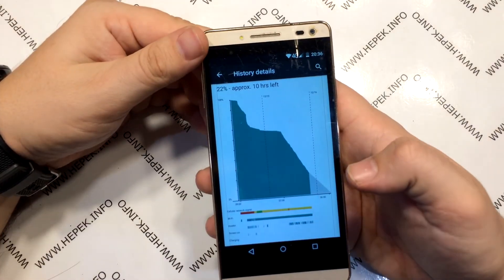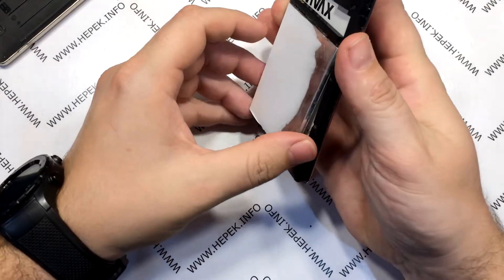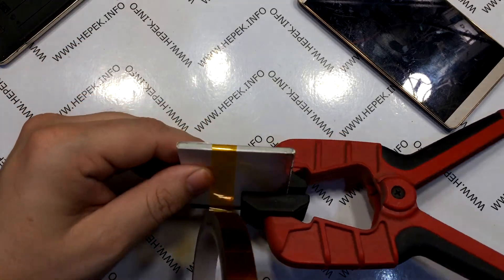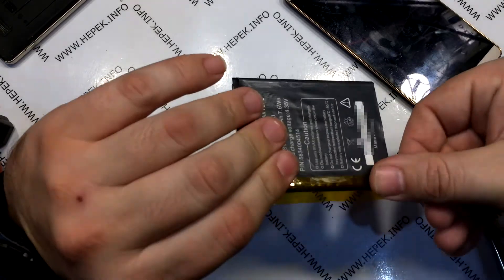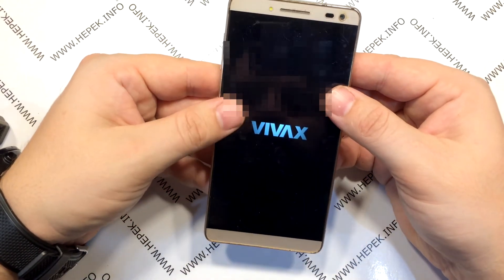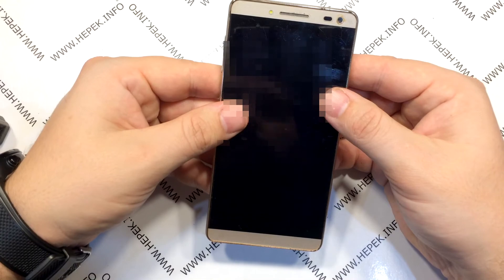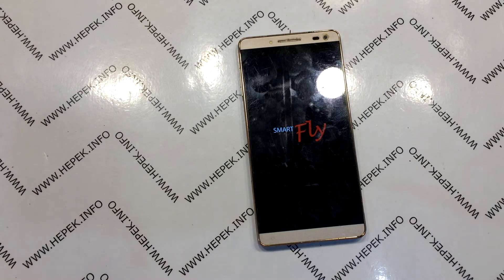I'm not sure how accurate this prediction is, but anyways, the smartphone was in relatively active use. I do a graceful shutdown, take out the battery, and put back the original sticker. But first I use fireproof tape to fix the plastic to the cell to hold it tight. I put back the original label to the original position and additionally tape it with fireproof tape. I turn on the device. I have to tell you — it's been more than 6 months since I made this battery, and the same still works. Although I do not recommend making such alterations for the purpose of everyday use, except for data recovery or some urgent necessities.